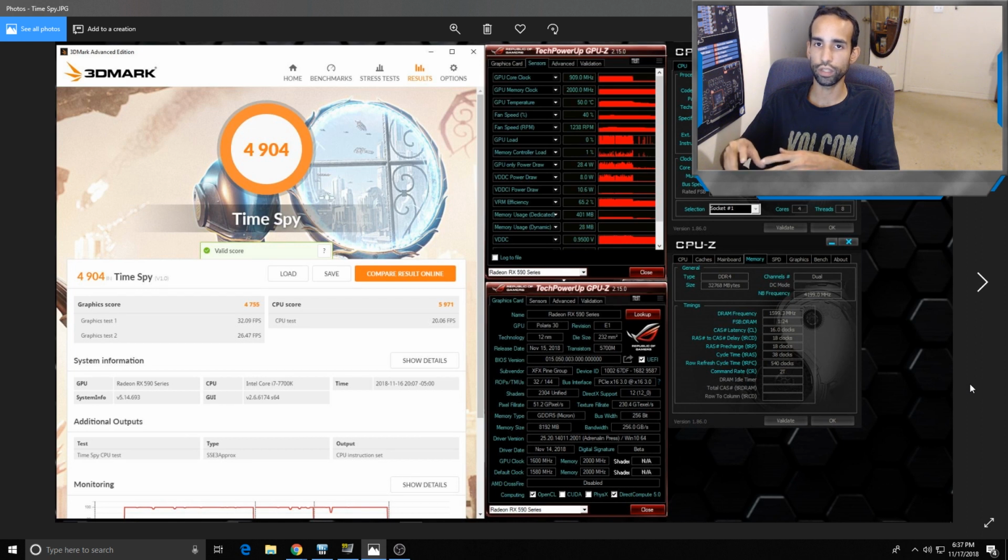The memory clock during gaming or graphic benchmarks didn't like it too much. Even 2050 didn't like it too much. However, it's adequate for what it has and what it does. The highest temps I saw was 78, but average in game was around 68C. So it's not a problem at all.